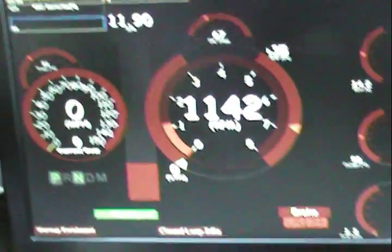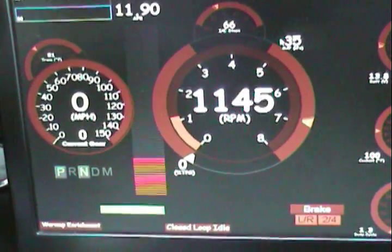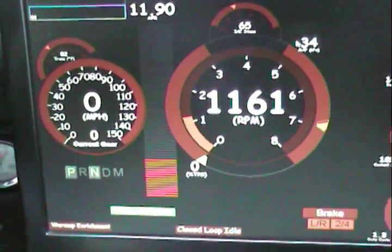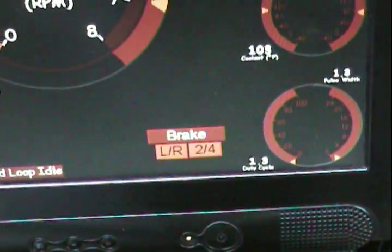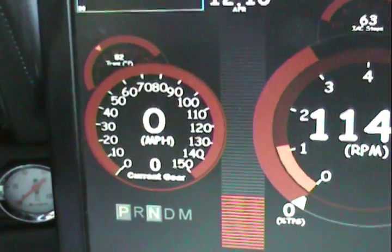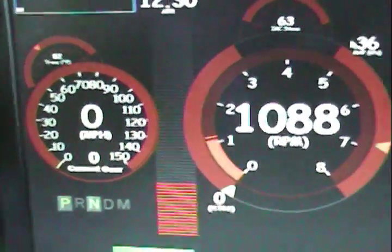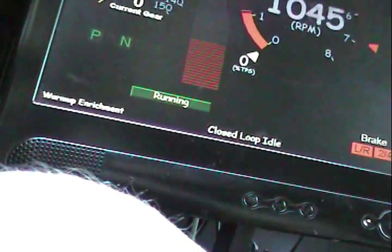I got my better camera this time and I've redone the VR wiring — it's now shielded wire. I grabbed an old RCA cable and cut the ends off of it. Miles per hour is zero and solenoids are running, so it's a good sign. I also routed the wire far away from all the other wires in the engine bay — it goes across the core support, across the radiators, and straight to the transmission. Should be noise-free if that was a problem. Let's put it in drive.